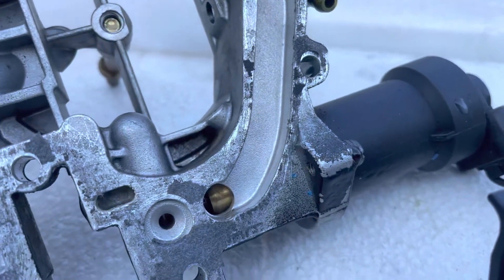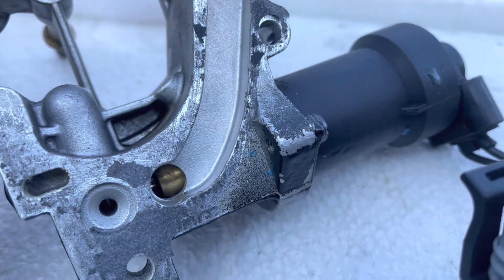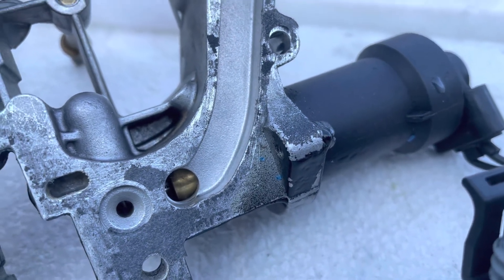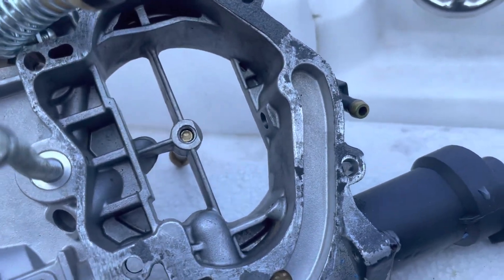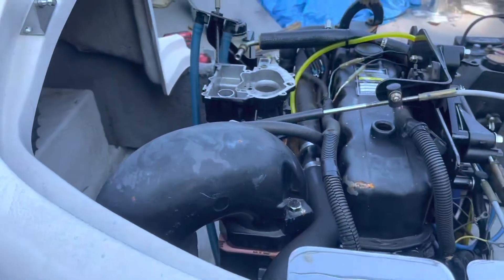The problem is that you're banging on the bottom of a carburetor, and there's a possibility you could blow right through the bottom. This carburetor is made out of lightweight aluminum or zinc, and if you hit it hard enough, you'll just bust right through the bowl of that carburetor.